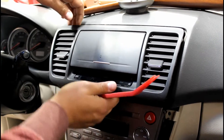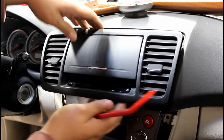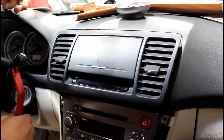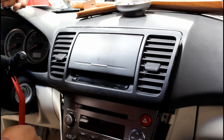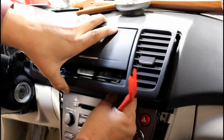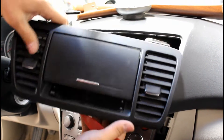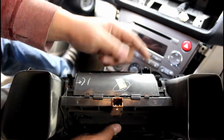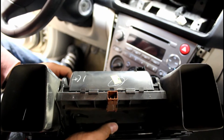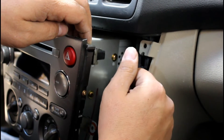Take your panel poppers and work your way around this piece. We need to get behind here to deal with the climate control wire — rod, whatever you want to call it. Pop this thing out. Then you're going to have some wiring underneath and you're going to want to unclip it. You have one connector on top, one on the bottom — push the button from the bottom on the bottom one, the top one from the top. Then push this clip and unclip the emergency flasher button.